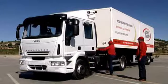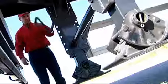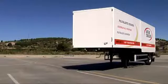The decoupling procedure involves: the electric and pneumatic hoses are uncoupled and stored appropriately. The fifth wheel is uncoupled. The support legs of the semi-trailer are lowered. The truck is decoupled and then driven around the semi-trailer to be recoupled again.